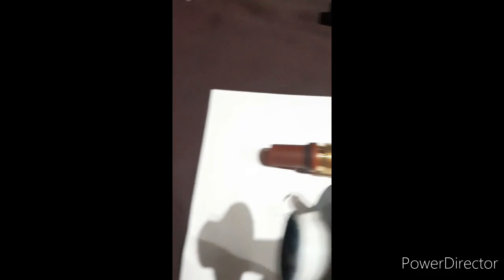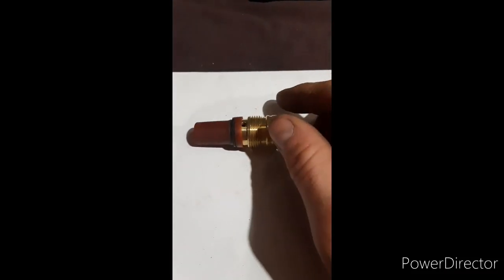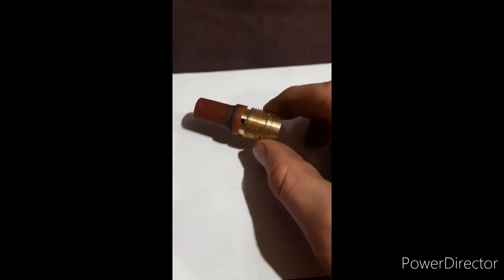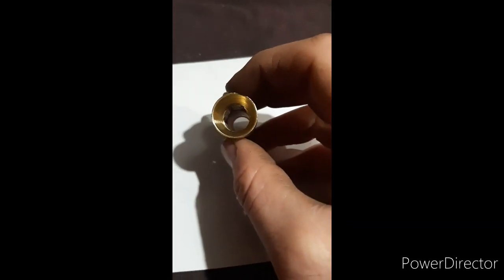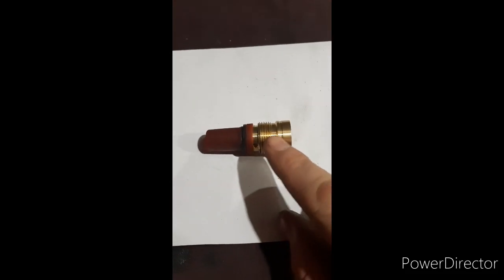All I've been using is cheap and cheerful PTFE tape — perfectly good enough. I'm reluctant to use any thread lock in there, because if they need to come out again, you've got brass versus aluminium versus whatever chemicals in a thread lock, and the old ones were very hard to get out. They do come out with a hex bit sitting inside. So all I'm using is PTFE tape around the thread.